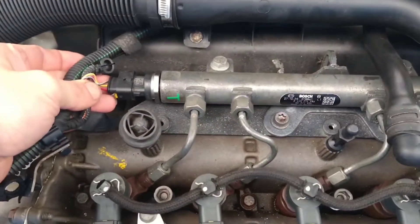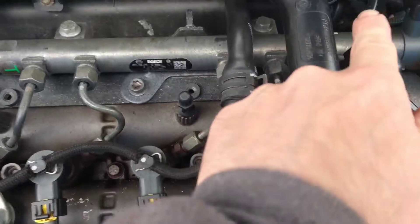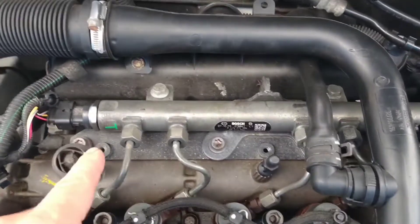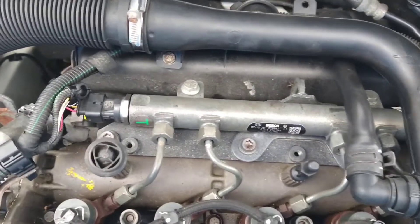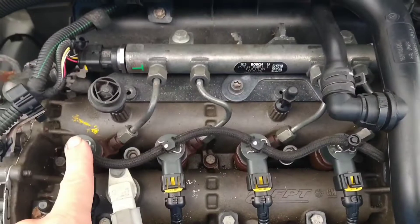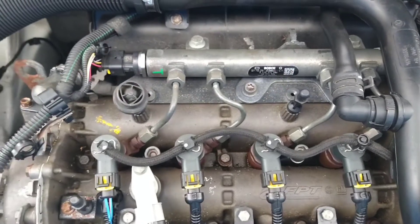I had no pressure on the scan tool, so we did some tests. We've got plenty of pressure at the pump, so we know the pump's capable of providing pressure. We've got the common rail — that also had pressure. The same pressure I was getting when I went into the pump. So the reason I did that test twice, testing there and then again here, was just in case there was excessive leak-off.